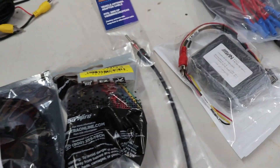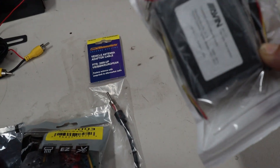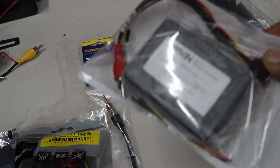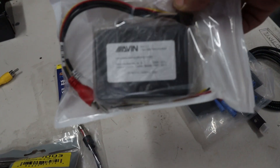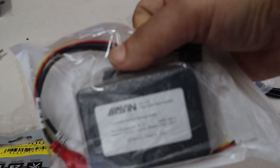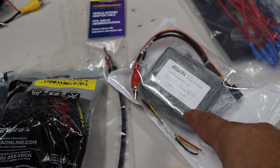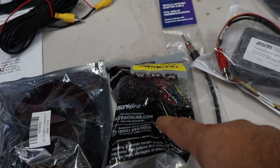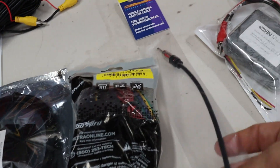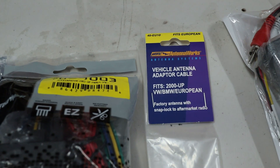You're not going to use all the pins on the wiring harness — it just adapts from the Kenwood over to a couple of simple wires you do need. The Cayman S with the Bose system uses a fiber optic type of wiring harness. The MOST box is going to simplify things and allow us to use our OEM Bose amplifier and speakers and make everything compatible. This is made by Avin — I'll put a link in the description — they ship out of California and I got it in three days for about $100.